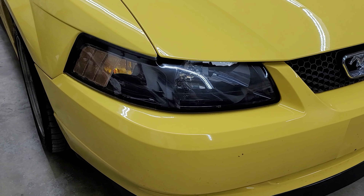Alright, so I went ahead and pulled the headlights out — very simple to do, just two tabs. There's one here and one there that you have to pull out. These metal brackets slide right into the headlight, so I just had to pull those out and pull the housing out. For the best results, there's a rubber seal that runs from one side and ends in the corner here, so I'll take the seal off. You kind of have to work it to get it off, but this way I can get a nice, beautiful finish on the headlight. If you leave the seal on, you have to tape it off and you won't get a nice clean finish. You start from the bottom and work your way up — it comes off. In some areas it feels stuck a little harder, so just be careful. We're going to reinstall those when I'm done.